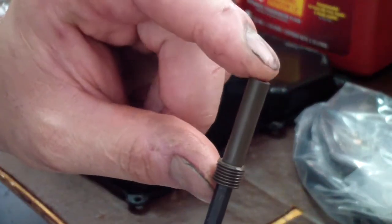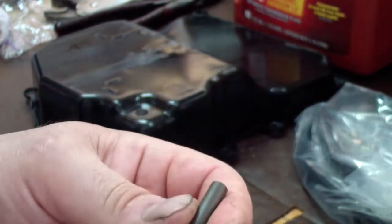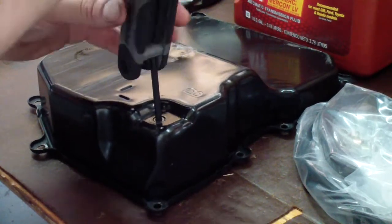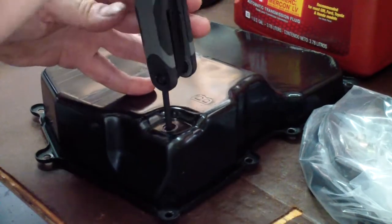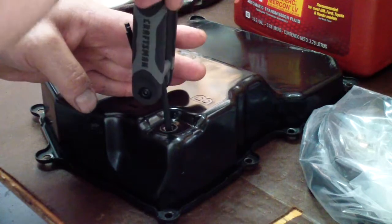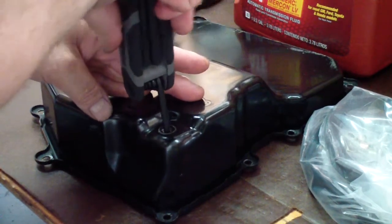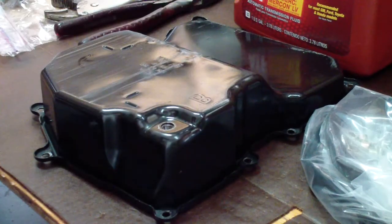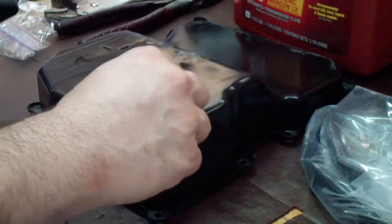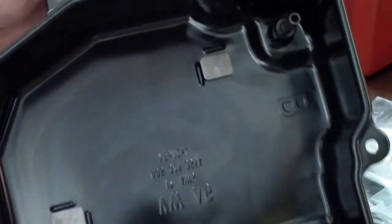This is the level that the oil will drain to. It's made of plastic and will take a 5mm Allen wrench. We need to make sure we tighten it all the way down but don't torque it too much or it will strip or break. If it's too loose, it will not allow the drain plug to completely seat. I'm just going to reuse the old drain plug. I'm not going to tighten this because we still have to check the level — just going to touch it up so it won't leak. The magnets are in place.